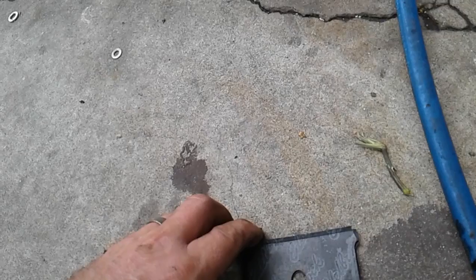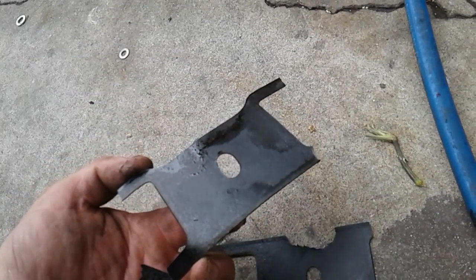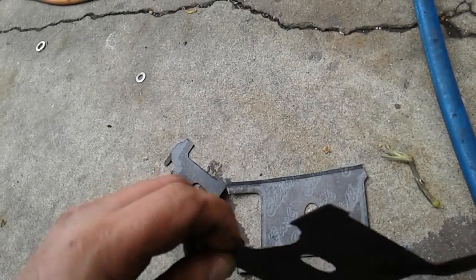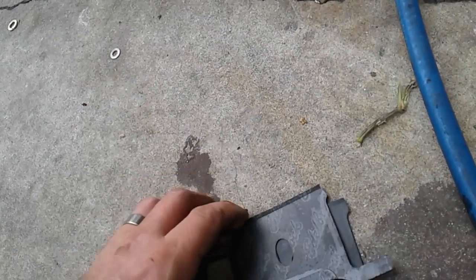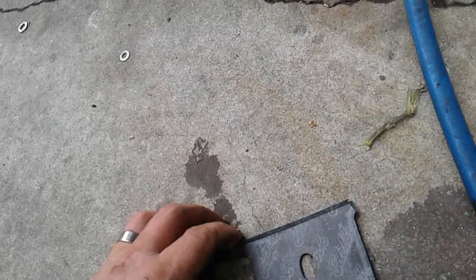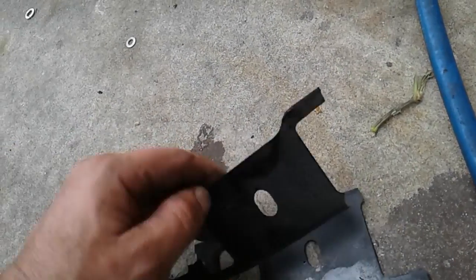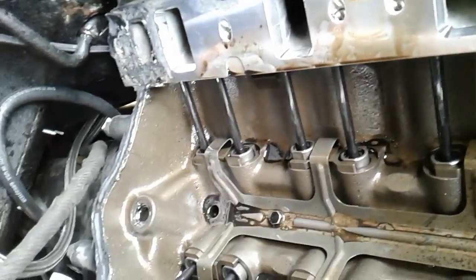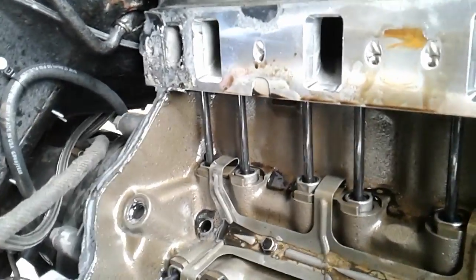The gaskets either — they gave me two gaskets but they were bonded together perfectly like that. So I'm guessing they didn't heat treat it right, or I don't know what the deal is, but that's freaking annoying. That's the Edelbrock 7220, and the same thing on both sides. Regardless, this is total gasket separation, so I have to clean up all these surfaces.